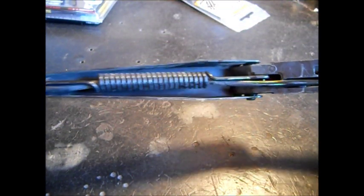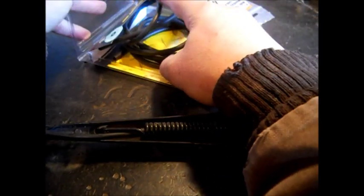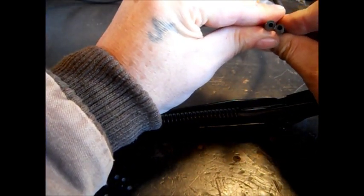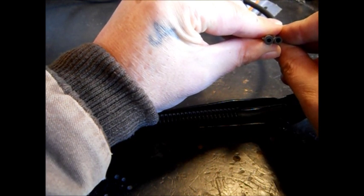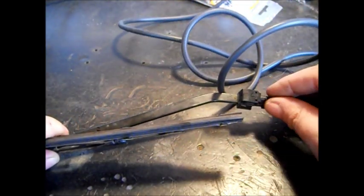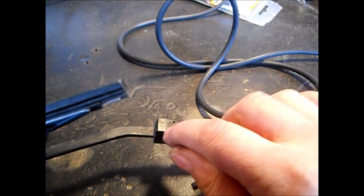We'll be back when we get the new hose in here, showing whether we have to go beside this spring and zip tie it. If it won't go through the spring, we'll go beside it. I'm not thinking it's going to go between it because I've already looked at the diameter. This is going to be bagged of course, because it's wallowed out from being shoved over the barb — it swells up. I already tested it — it will go over there. I may have to warm it up or spit on it. Just don't use anything that will clog it up. Before I put it on the washer end, I may turn the washer on first to blow out any particles, because you do not want to plug that. People take sewing machine needles to put in there — that's where it sprays on the windshield. You want to take it off, pump it a couple times, then stick it on.